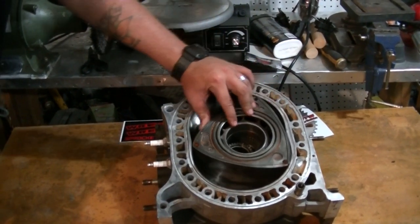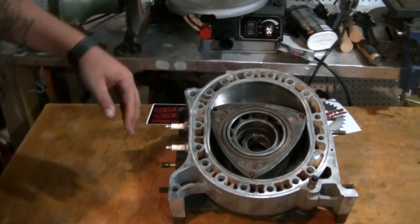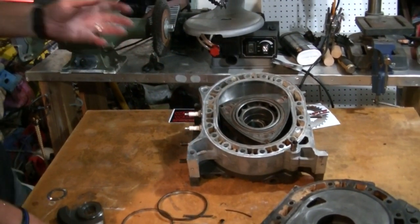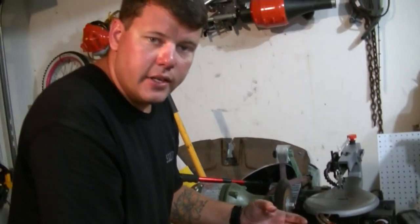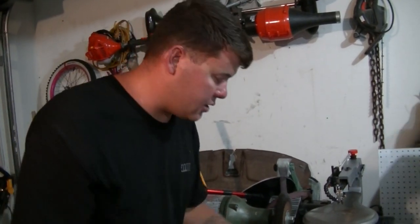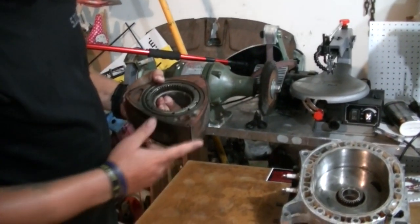So many of you have seen the process of the rotary engine. I know I have posted several little animated video clips, so on and so forth. Aside from this, a lot of you know the basic idea that the rotary engine is not the most reliable in the world, and everybody says apex seals, apex seals, apex seals. This is where we get into premixing. So as I pull this rotor, you'll notice that the rotor has three apexes on it.